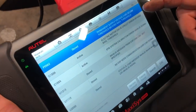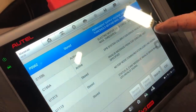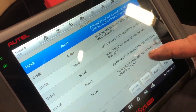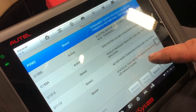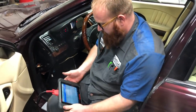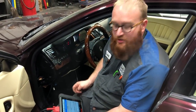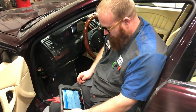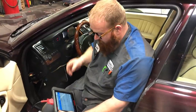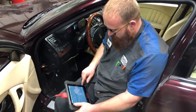The only other fault I have is with the parking brake. Let's go check that out. The battery — I didn't like the battery. The electric motor drive circuit beyond maximum. Calibration error. The CAN communication line is not specified. No signal. Invalid message. Main wake up. In English, please. Probably the motor and all that stuff is dead. We'll take a look at it and see. Maybe there's some cut wires. This has a lot of communication issues. You think one of those could be draining my battery since they're all confused? Yeah, if there's something shorted or something wrong. So that's all the stuff I know is wrong — let's put it on the lift and see what else there is.